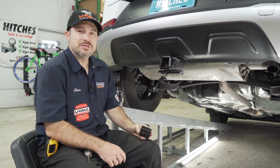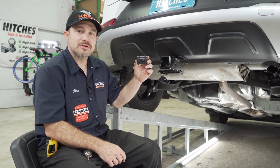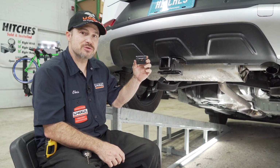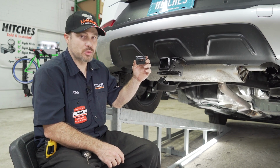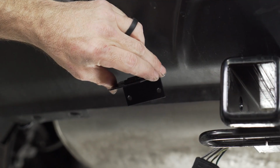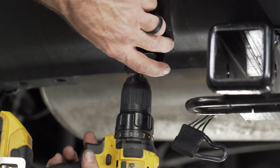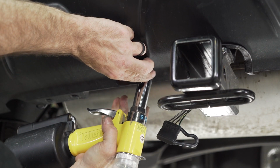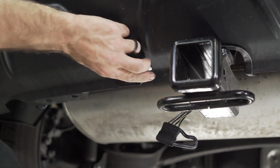Our final steps will be to mount the 4-flat wiring connector to a mounting bracket. If you do not have one of these, you can purchase one at your nearest local U-Haul hitch center, or you can order one online, and I will link it in the description below. Using the bracket as a template, you can drill out 2 holes using a 3/16 drill bit. The bracket will come with 2 different forms of hardware to secure the bracket.